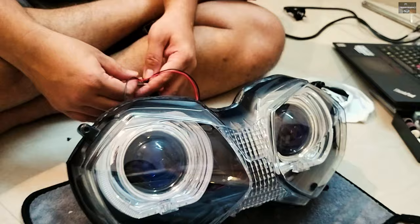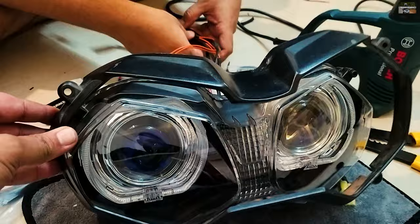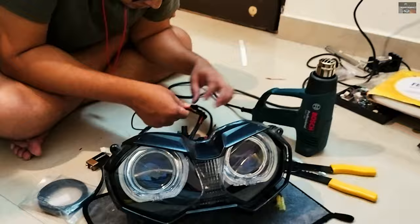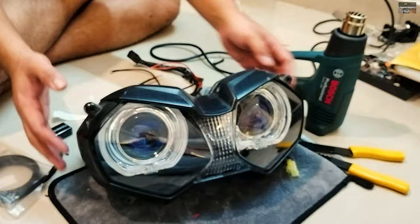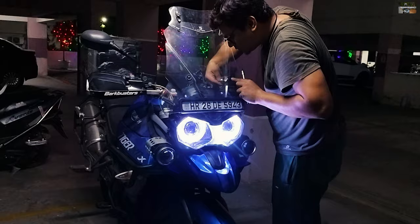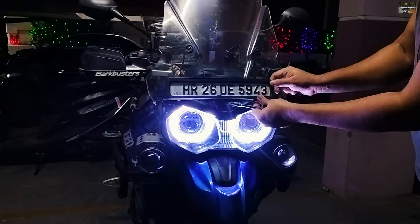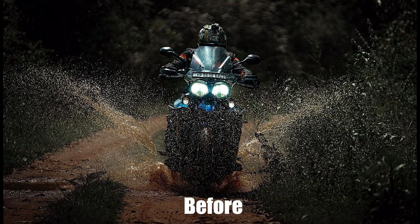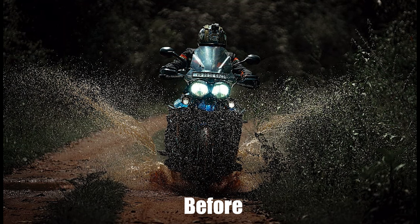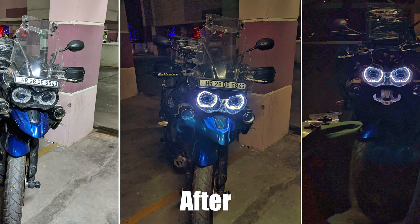The DRLs were tested and worked fine without any issues. I put the crown back onto the glass and installed the headlamp back onto the bike. For the wiring, I used the stock connections without any relay since bi-LED projectors consume very little power. The final result looks absolutely fabulous with the projectors and DRLs on, and the output just baffled us — it was amazing. I hope you liked the video; if you did, give it a thumbs up, share it, and consider subscribing. Thanks for watching, have a nice day!